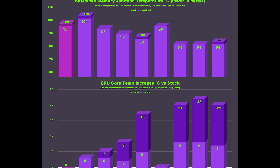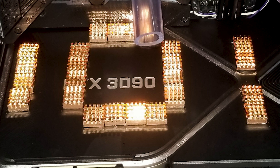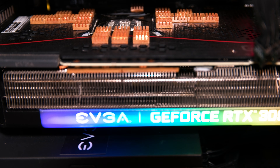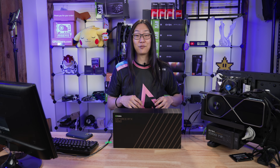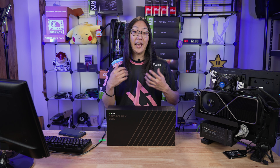One thing I would like to take a look at is the addition of RAM sinks to the backplate over the backside memory modules. I know there are mixed opinions on the efficacy of such heat sinks on GPUs, but it would make sense that they would actually prove much more effective at removing heat from the card after it has already been repadded and is more efficiently transferring heat to the backplate in the first place. So let us know if there is something you would like to see, and leave your question in the comments below. Thanks, Andrew. Well, there you have it — we've been wanting to do an in-depth thermal pad video for a while now, and this 3090 was the perfect test subject. I hope this information was helpful to any of you considering buying thermal pads. Leave a comment down below with your thoughts. If you like what you saw, consider getting subscribed and checking out my other videos. I am the founder of the Misfit Mining Discord — link in the description below. That's it for this one, guys. Thanks for watching. See you in the next one!